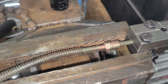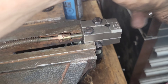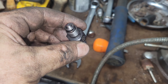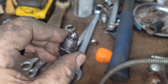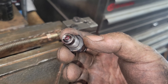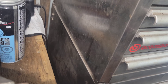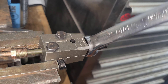Once you have these cranked down, you're gonna need your wrench. Just back that off and you can spin it out by hand. This is the tool here — you want to put this end in first, which is the cup side, and that will double-flare it. I've got to open up my little grease container — this all comes with the package. Put a little bit of grease on it, then go ahead and put this thing in.